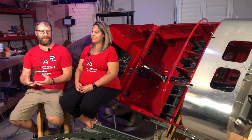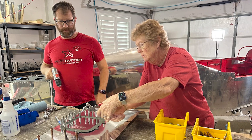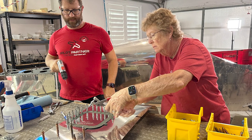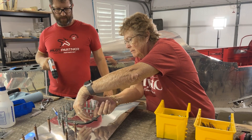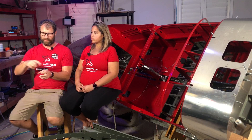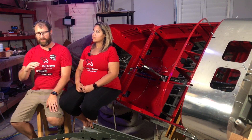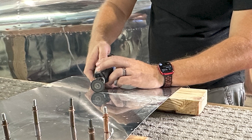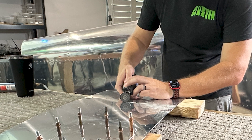So we went through and did it. It's not that intimidating, well — it is intimidating when you look at it. It's like, wow, I'm going to cut some big holes in here. But it's a pretty simple, straightforward process where they send you the ring, which acts as your template at first. They tell you for your model, whether it's an RV-6, 7, 8, 14, or even 10, what hole to click the template into. Then you match drill all the other holes where it's just in the skin, trace out the area you need to cut. Just like with the JD air latch, when you do the cut-in you start small — you can always take more metal off, you can't add more metal back.